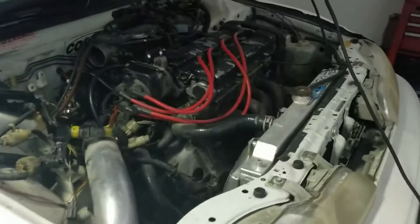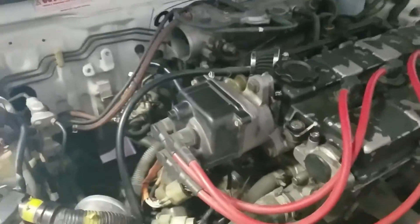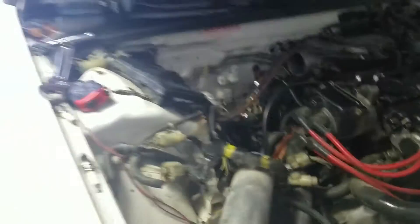I just wanted to show you a few little things. We were talking about the Integra last time when we were pulling the engine out of the hatch, and just wanted to show a little bit of progress. We did end up finally getting the O2 sensor put in, got the shift linkage buttoned up down below. We had the main fuel relay replaced, so now it starts up with no check engine lights. Everything's running good. The only thing we got left is to weld up the exhaust, because right now it's just a straight header with about a three-inch gap between the rest of the piping and the header.